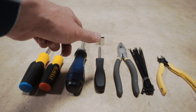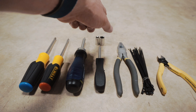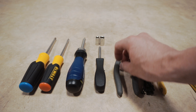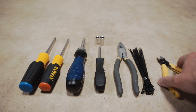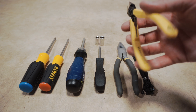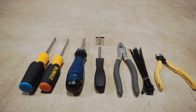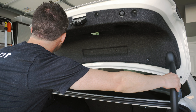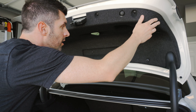Going over everything we need for today's install: a Phillips screwdriver, a flathead screwdriver. For the 2016 F80 M3 it's a T10 Torx; if it's an F30 it might be a T20 or T25. You'll also need an 8 millimeter and 10 millimeter socket, maybe some pliers if you have trouble reaching a retaining clip, zip ties, and a good quality pair of snips — don't use scissors. I'll leave a link in the description below.